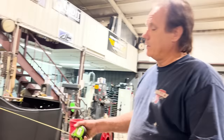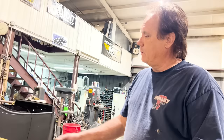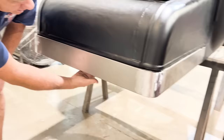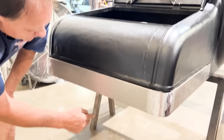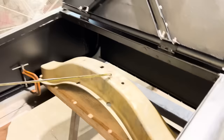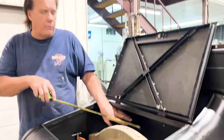So the question now becomes: do we want it to look like Ed's back here, or do we want it to look like Ed's from the side view? If we keep his wheelbase, we're going to have a rear end sticking out. If we shorten the wheelbase, it's going to look a little different but we won't have a rear end sticking out - we can have the license plate and taillight. So after looking things over, measuring, and talking to Nolan - of course he leaves it up to me, but I want to include him - we've decided to shorten the wheelbase four inches. That will keep the quick change up inside the car. We found a gas tank that will fit in here - nine and a half gallons, stainless steel, round, looks really cool. It should just fit right in there.